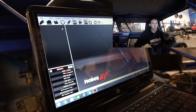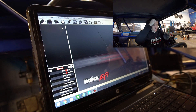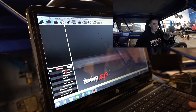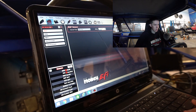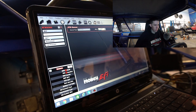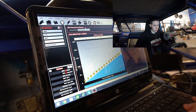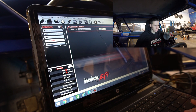We got a little leak - we got a pressure leak. That's maybe why we don't have oil pressure. That needs to be tightened. It's right by the sensor. You're using the Holley 100 PSI thing for oil pressure - okay, so I need to change that in here too. Coolant temp is still GM, manifold air temp is GM I believe. Oil pressure right here: Holley 100 PSI. Now that should read correctly. Fuel pressure is Holley - so that's all good.